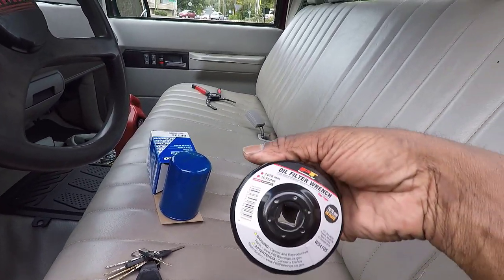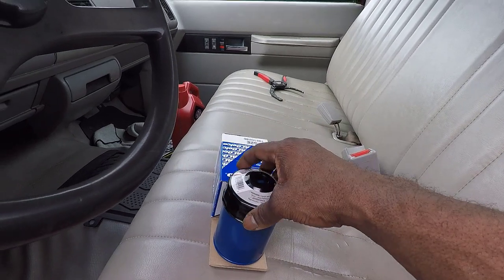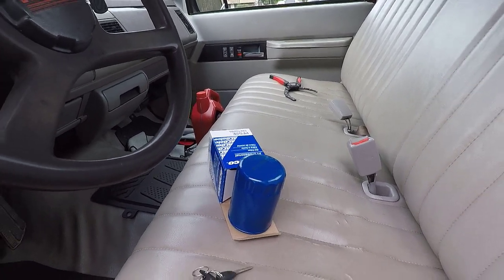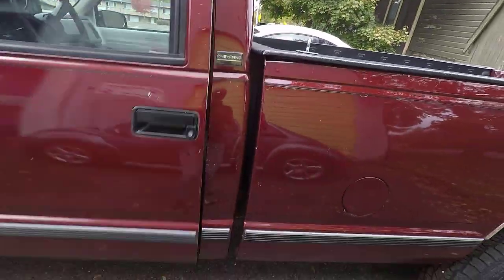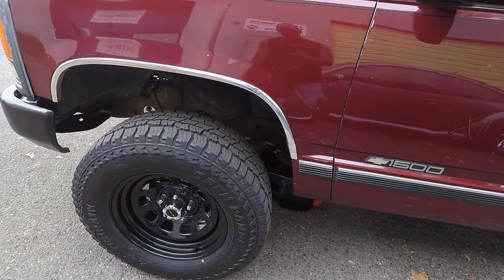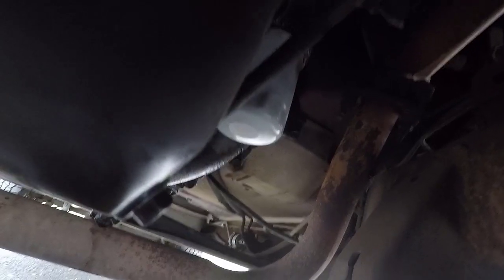I'm back from Advanced Auto. This is what I wanted — an oil filter cap wrench. This one is 74 to 76 millimeters, and the way it works is it's got grooves that fit right on top of the filter. Let's hope the one underneath the truck is exactly the same. I've also seen someone say it was easier to get to the oil filter by turning the tire — I'm not really going to do that, but just FYI. Okay — confirmed this does fit, and it actually fits just fine once I had the wrench on there fully. So let's get this oil filter off.